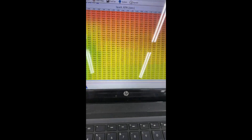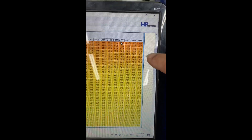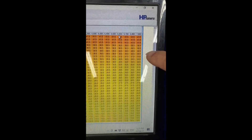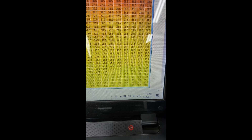The car also has very low compression, which is good for 98 fuel. Into our spark tables, we're still running high and low octane spark tables. On the high octane table — we don't do this to normal cars, but for this boosted Procharger car — we've changed the axes quite tight. We went from 6,400 to 6,600, 6,650, 6,700, 6,800 — I wanted to control the timing there for a Procharger, because Prochargers run with boost that keeps climbing even after peak power.